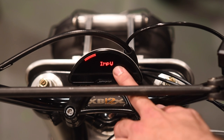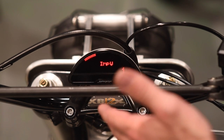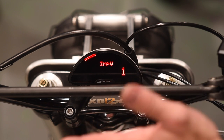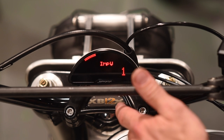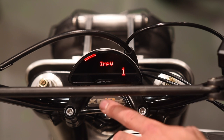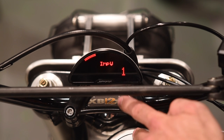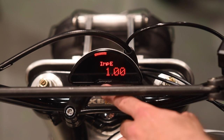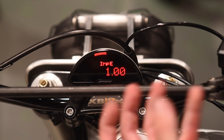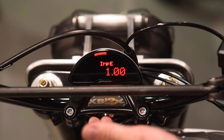The impulse W setting is the impulse wheel — right now set to 1, meaning one impulse per revolution of the wheel. On this bike, that's part of why we get that 624 mph top speed reading, because this bike actually gives about 30 impulses per revolution, so we're reading 30 times faster than we actually are. If you're using a reed switch with one magnet set it to 1; with two magnets set it to 2. Next is impulse E, which is the tachometer calibration. Some ignition systems fire every revolution, some every other. Depending on your bike, you may need to set this between 1 or 0.5 — check the tables in the manual.